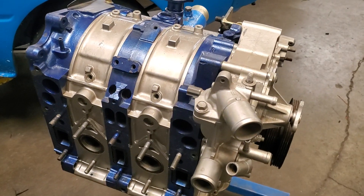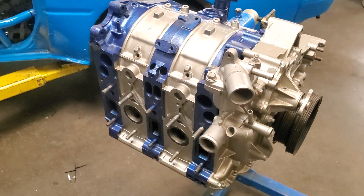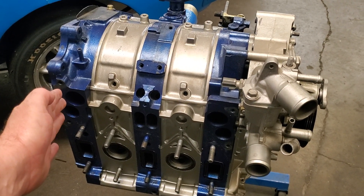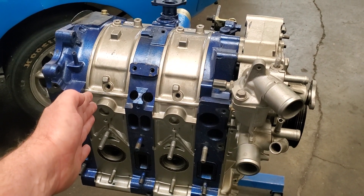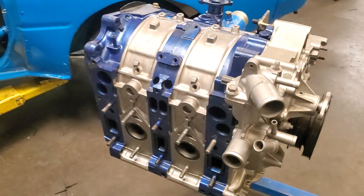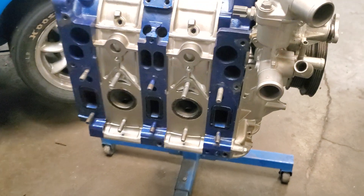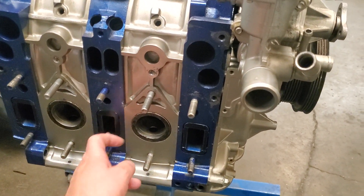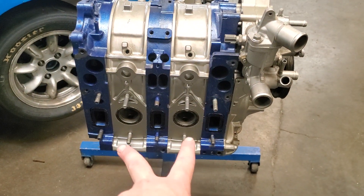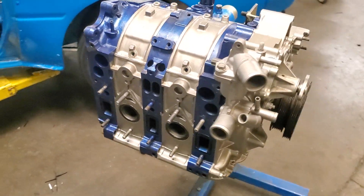One of the biggest questions I get about these builds is: where do you get the components, what makes them special, what is unique to this build? Starting off right there — RX-8 side plates do not have water o-ring grooves. They went back to the earlier style with water o-ring grooves in the rotor housings. That allowed us at Mazda Trix to put those GSLSE rotor housings in there because they bolt right in, giving us a five or six port exhaust. The center is divided, giving four OEM ports plus two peripheral-style ports via the additional exhaust — a six-port, multi-port exhaust. We call them hybrid builds.